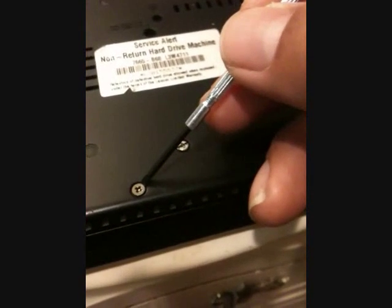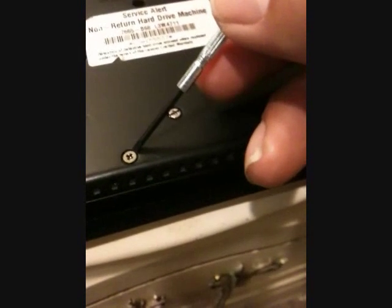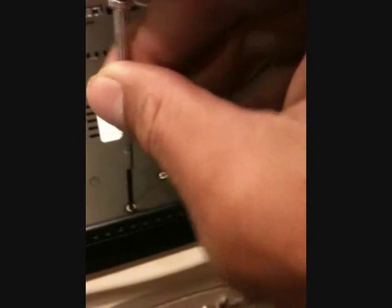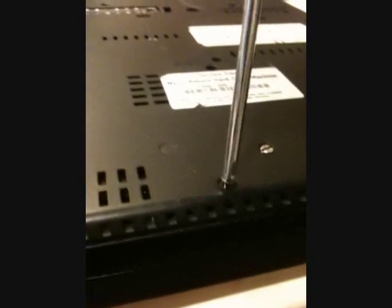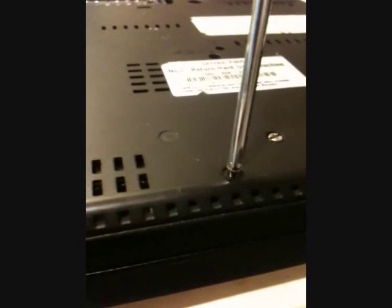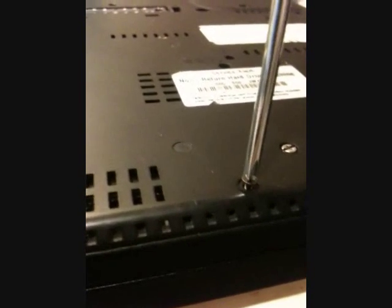But this one is pure Phillips. And to my surprise, I found out that the flathead has more bite and less slip than the Phillips. But when screwing in, use the Phillips driver initially because it's easier to keep it upright while you are still trying to thread it in, since these screws are too small to hold with your fingers to keep them upright.